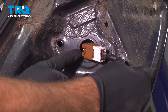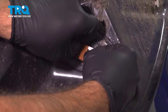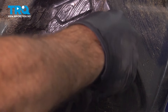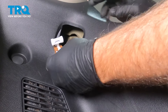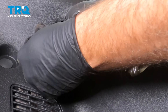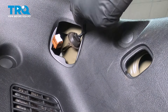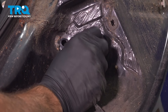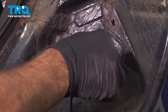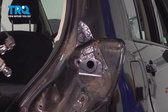There's a little connector right here with a little brown tab. I'm going to press in on this tab and separate this, then try to feed this through a little bit to the inside of the cargo area so we have this connector. I'm going to push in and pull this off. Pull that rubber grommet right through, just like that.